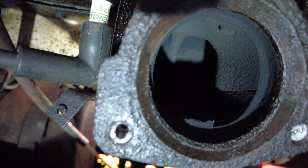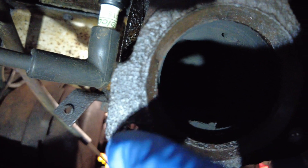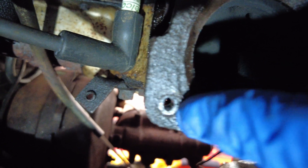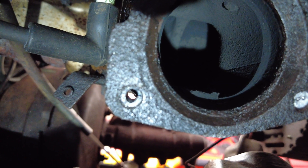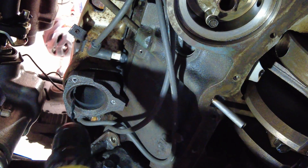Back underneath — you can see I am progressively getting that bigger in diameter, moving up on drill bits and slowly getting that done. I haven't started that one other than tapping it; this one is in progress, so it's doable. You have to be quite careful. Once I'm very close to that diameter I'm going to bring in a tap set and tap that hole to the right thread. I'm going to try a few larger drill bits and widen this a little bit more.